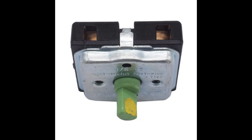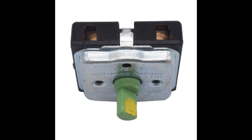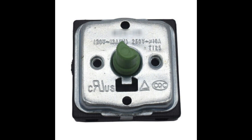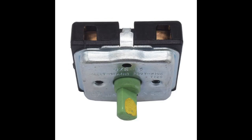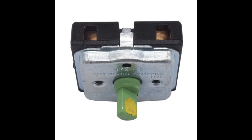You have to remove that square metal plate. There is a plastic square plate underneath that metal. Then you will remove the plastic axle, and on the bottom you will see a star-looking copper plate. Make sure you know how to install everything back together. And the star-looking metal plate can be attached to the plastic axle in 4 different ways. You can also install it upside down, so it will be hard. So you better mark everything and scratch. Don't use a marker. Marks will disappear.